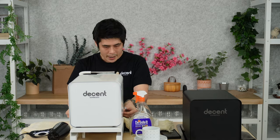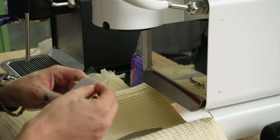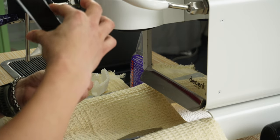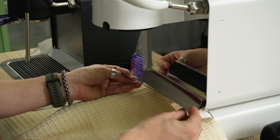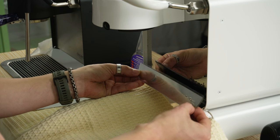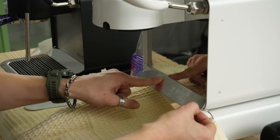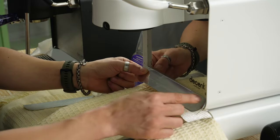Now that we've got a feel of how it will fit in, we are ready to remove the adhesive sticker. Rather than just sticking it in one go, the better technique would be to let one side stick first after aligning. Similar to the tablets, you're just going to pivot it onto the edge and then, with either the left or right hand side, stick that side first. I'm just running my left index finger all the way along making sure I don't have any bubbles and just making sure that it is seated.